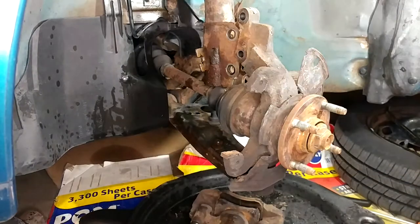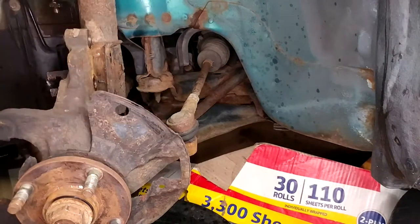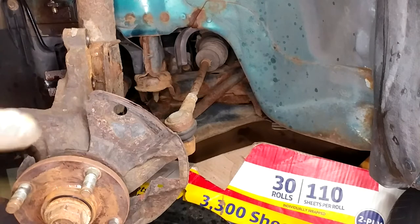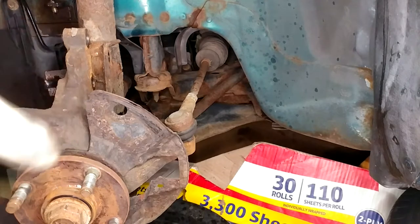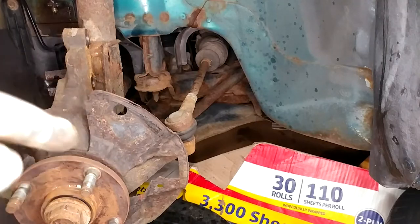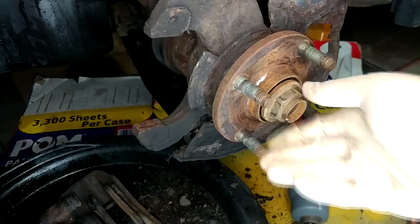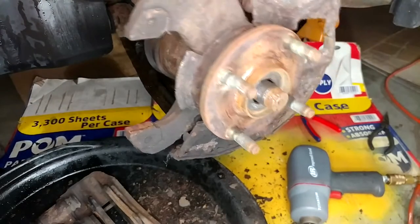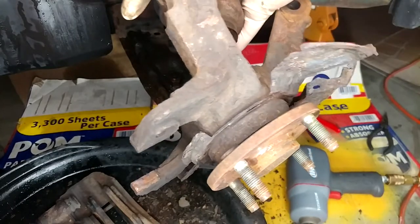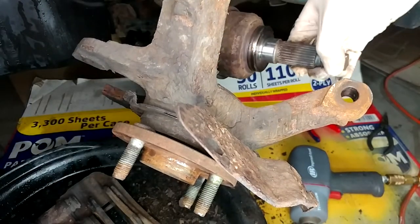As not part of this video, I'm actually replacing all the steering too. So that tie rod end, the inner, and the other side — that's all going to go away. Once I do that it'll be a lot easier to remove this axle. I'm pretty sure you can do it just by cranking the wheel and taking the ball joint out of the bottom. But since I'm getting rid of all this stuff anyway, let's see if we've got enough play in the knuckle to get it off the half shaft now. Got the half shaft out of the knuckle.